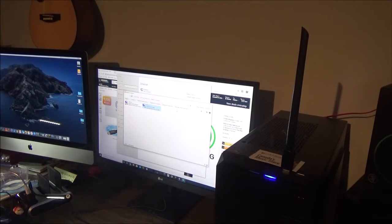Her Ethernet connection, which she's currently running, it doesn't matter, and I'm going to tell you this because it's actually true. It doesn't matter how fast your Ethernet card is. We're running the newest, fastest gigabit cards for Ethernet. It's what that modem on its Ethernet port is feeding you that is what you're going to get, okay? And they're not all that fast. She's only pulling in 100 megabits per second on her Ethernet cable.